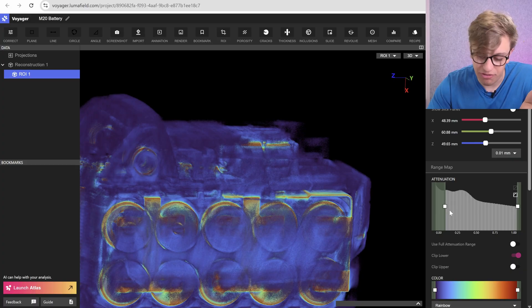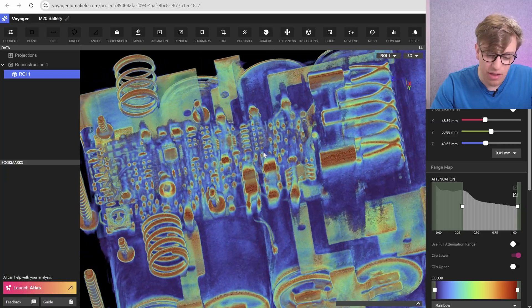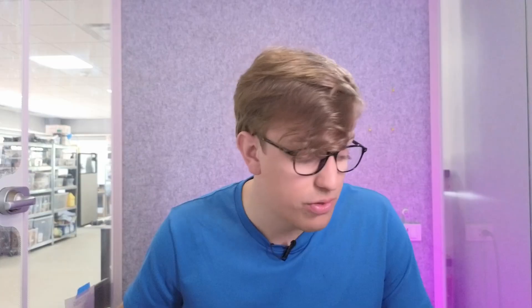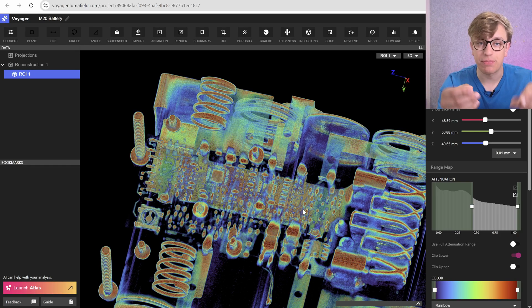The other crucial detail to making sure your battery doesn't catch fire is to make sure the cells are balanced. With nickel-metal hydride, you could just keep shoving charge in — the cells would get hot, but they would all eventually stabilize at the same level. With lithium-ion, you cannot do that. It's very bad if you don't balance the cells actively while charging. This circuit board is equipped to individually monitor the voltage of every cell — there is a microcontroller specifically able to do that. You can see all the tabs going to all the cells individually, and those tabs go to solder points on the circuit board so they can be individually monitored. You also need to be able to tell if the battery is about to burst into flames from over-discharge — easy way to do that is just check the temperature. Things that are about to catch fire tend to be hot.